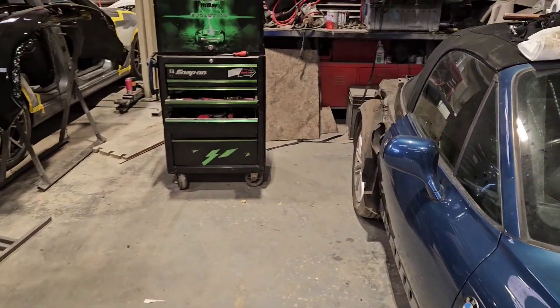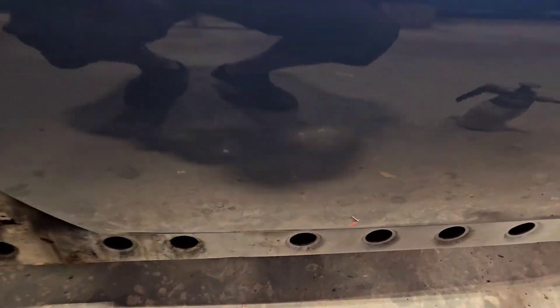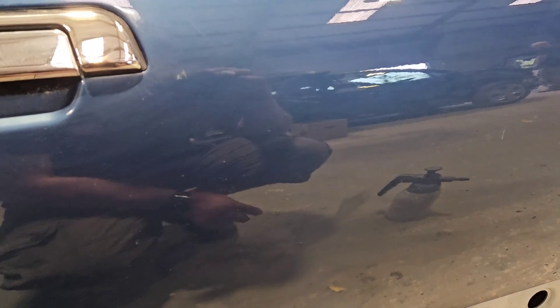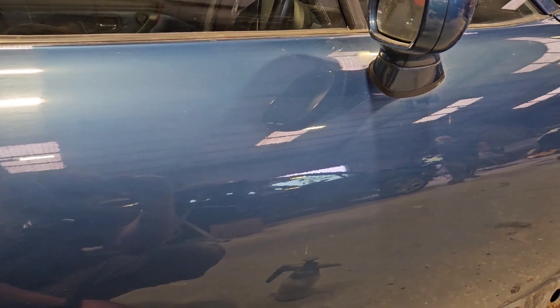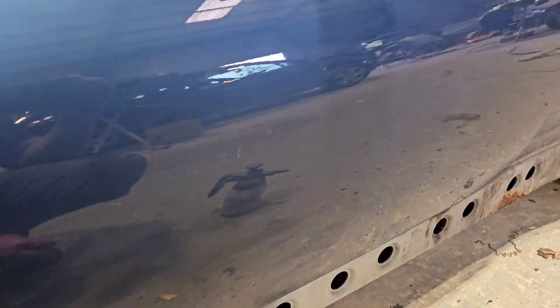Get the bumpers ready and then I have all the panels I need including the sills. So I'm going to get a bit of sandpaper and basically just sand down and highlight marks like this one here. Then we're just going to use a bit of dolphin glaze, which is a self-leveling putty - don't need any big filler. Get that onto it and then get the door ready, get the mirror pulled off. I was going to take the doors off but I think it's going to be better actually on the car for the paint.